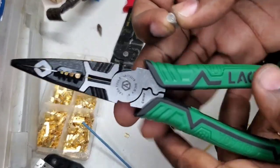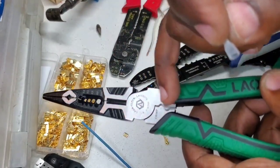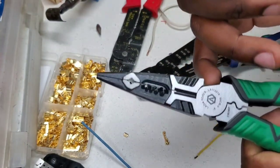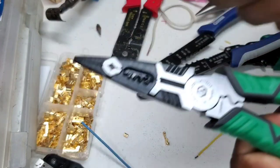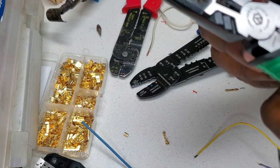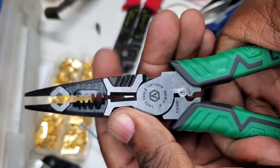This tool, just because of the size and the space on the crimp section, in a fully closed position will not be able to crimp this gauge. Here's one that's halfway crimped — I'm going to put it in there just to see how it does.